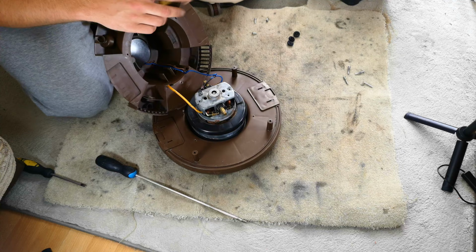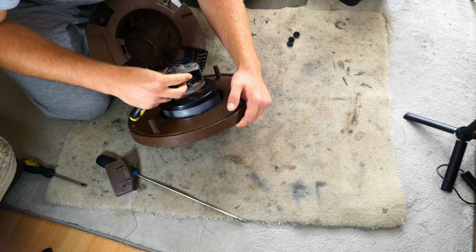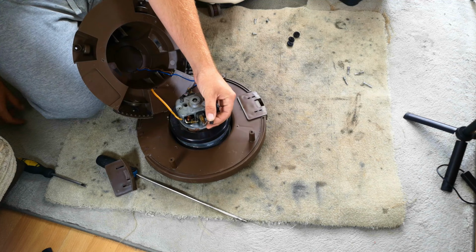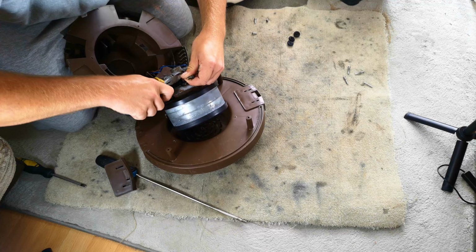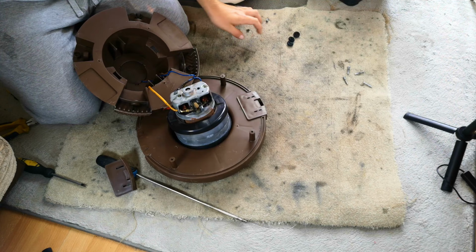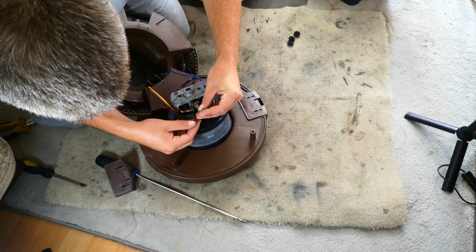So, let's pop up this very gently because we don't want to snap it. And then we can take out our tiny little nubs of carbon and go, yes, look at that. Perfect fit, and it's important to do that first because we've now got to chop off the old carbon brush, because the new ones have a little clip on the outside. So in fact we could possibly get rid of that bit of metal as well, but I just want to double check that it fits first before I go do something.